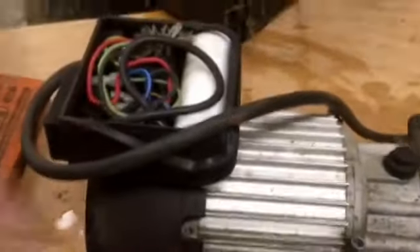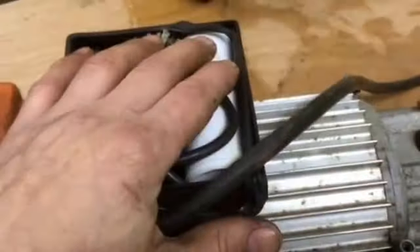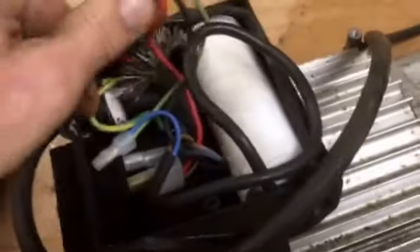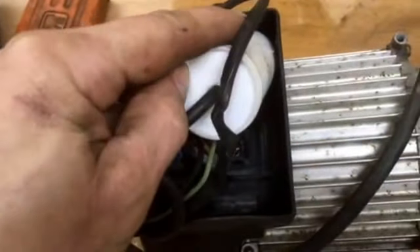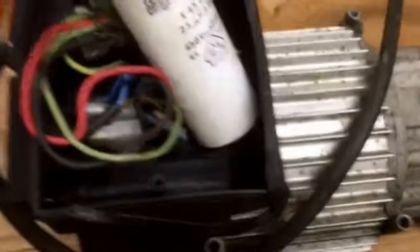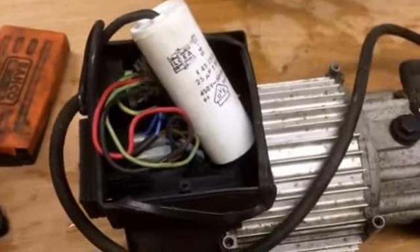Let's start at the very beginning. You switch your jet wash on and it does nothing. Check the fuse, the wiring — it's all very basic. It's a switch, a start capacitor, there's no intricate gubbins in these at all. It's literally power into the switch through a capacitor and off you go. If it's making no noise whatsoever, check your power — that's the easy bit. But if it's sitting there humming, or just blows the fuse...